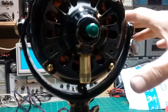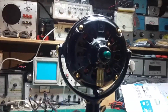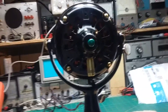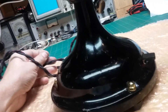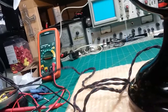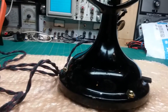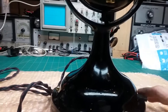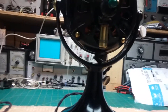The fan runs great. It has a tilting control where you can loosen it and tilt it up and down. It doesn't oscillate — it's not an oscillating fan, it's a heavy desktop fan. I don't think they even had oscillating fans when this was made. It's got a nice cord on it — 18 gauge — that was replaced. There's no way to really ground this one because it's got too many grounds inside on the centrifugal switch.